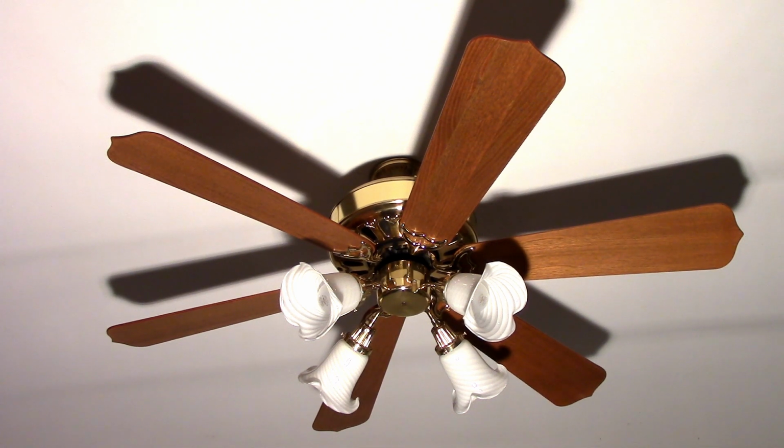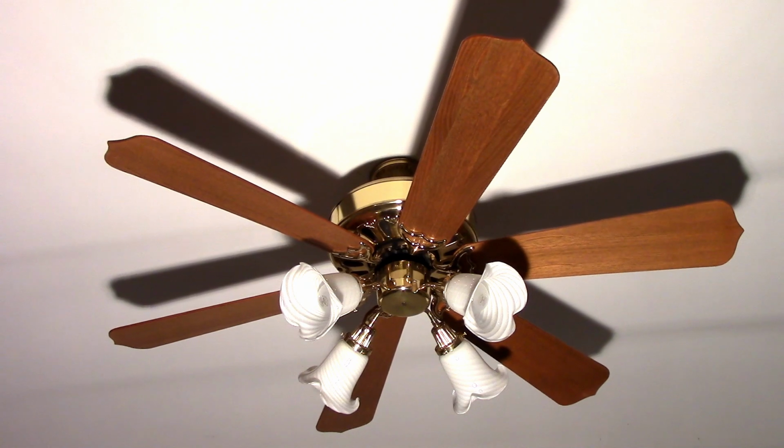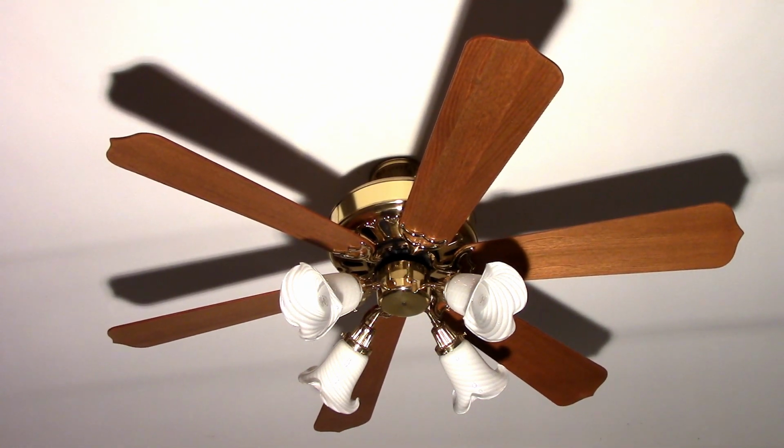And this was especially a problem for the superfan models, as DC motor fans, particularly the older ones, when they first turn on, they jerk about, sort of twitch back and forth. So if you have a hardened, brittle flywheel, and the fan is sort of twitching back and forth, yeah, that flywheel is surefire going to get obliterated.